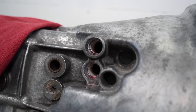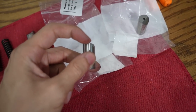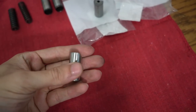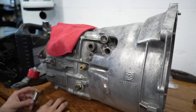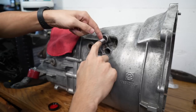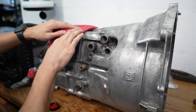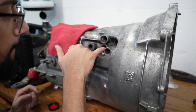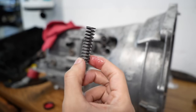Both brand new sleeves are fully installed and these two are very noticeably different — the reverse one has a bigger hole and the slant is perfectly flat with no bump in the middle, and then the fifth gear one has a change of face right there, a little bump in the middle, and a smaller hole. The reverse one is gonna go with the slant pointing downwards, and then the fifth gear one has to be facing up. The stiffer spring goes in reverse and the thinner spring goes in fifth gear.